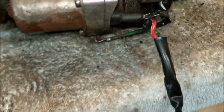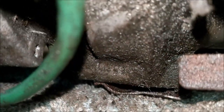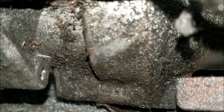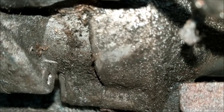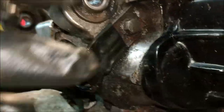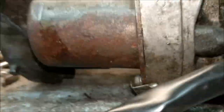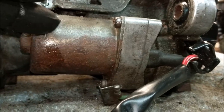Why is that so? Think about it, Eadsie, think about it, come on, man. What is going on? Ah, I've just spotted something. You've got an M8 bolt there, goes through. And that also goes on to the bottom of the starter motor, so there must be another one somewhere. So let's follow that through. Yeah, there it is. Okay, so I'm reckoning if I undo these two, that starter motor will come off then. And then you take the bolts out to get the motor out of that gear it was in.